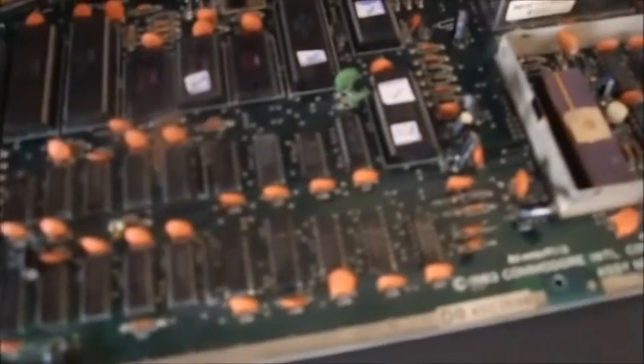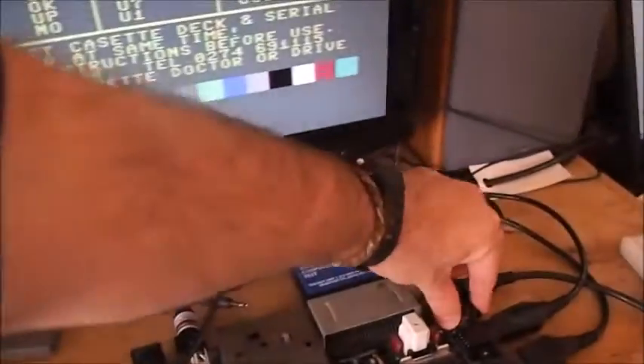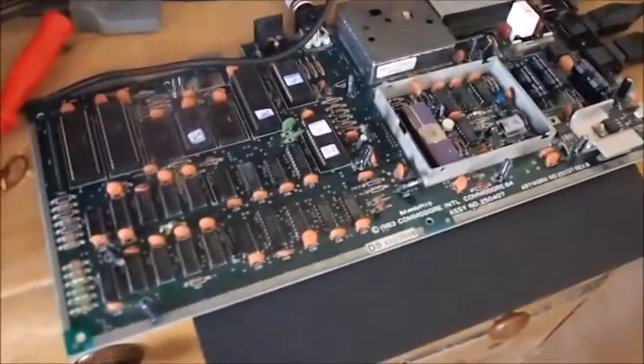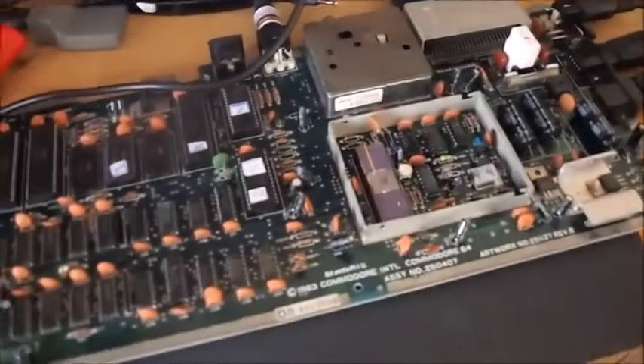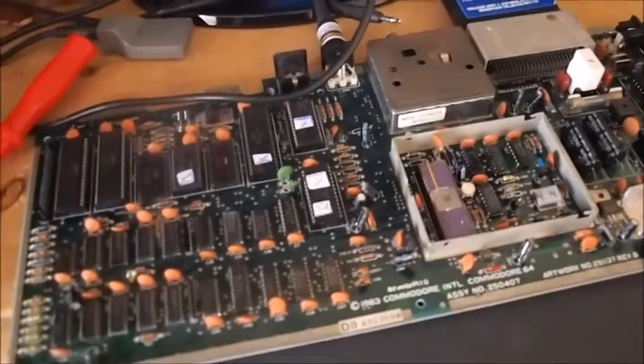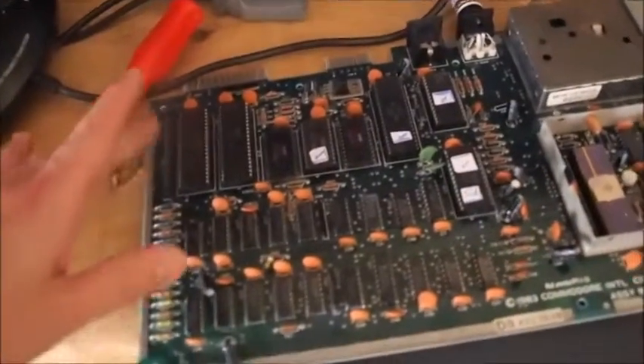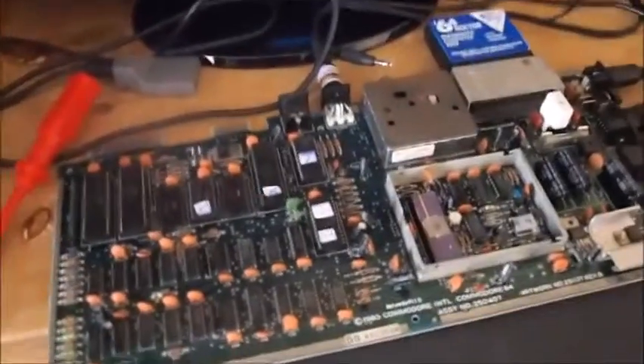So I've got a bit of a dilemma here. All the other diagnostics are fine. It's not the joystick — I've tried different joysticks — it's causing a problem with the keys. So either use it without the joystick and get a perfect keyboard, or use a joystick and get a keyboard with only odd numbers and letters. If anyone has a clue how to fix that, I've checked the circuit board and there's nothing obvious. It's like a conflict between the two — if anyone could figure that out for me I'd be very grateful.